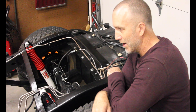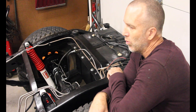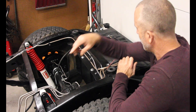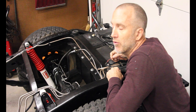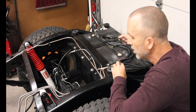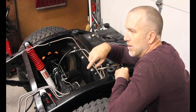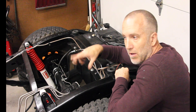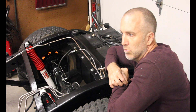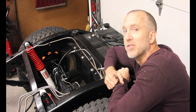So that's how you've grounded your engine and frame so that you don't have any of those electrical gremlins that relate to things like your rear brake lights or anything else that has to be grounded through the frame. You may be asking, why is it important to have the frame grounded when you can just run an electrical wire? Well, that could be a way of doing it. But one thing you definitely need to make sure is that your wire harness for your fuel sender is grounded to the frame. If you don't have the frame grounded — connected to the engine block, connected to the battery — your fuel sender unit won't operate. So that's just one example of why it's important to ground your frame to your engine, to your battery.